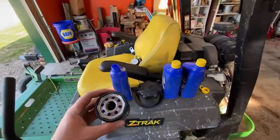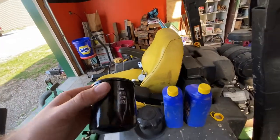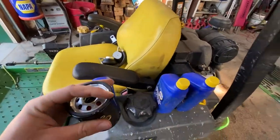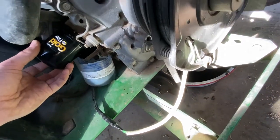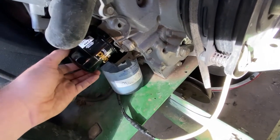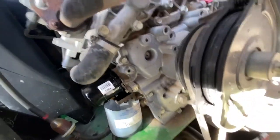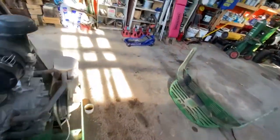For the next step in the oil change, take your new oil and smear it on the O-ring around the outer edge of the filter. I don't like removing them from the filter since they're firmly pressed in, but take your thumb and push down on it to make sure it's seated. Put a nice little film of oil on it, then thread it on - it should glide on easily. Go no more than hand tight. Do not use an oil filter wrench, just as hand tight as you can.